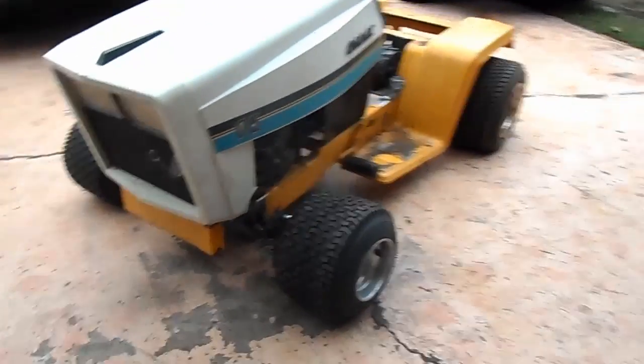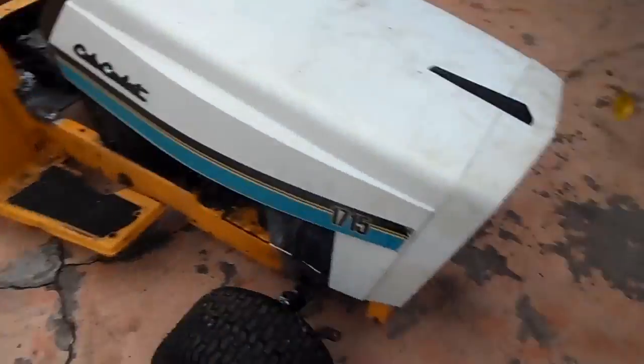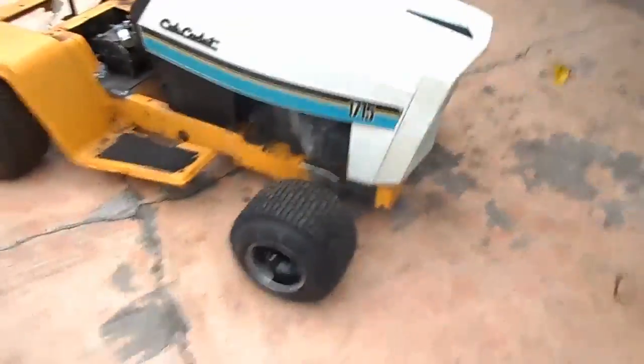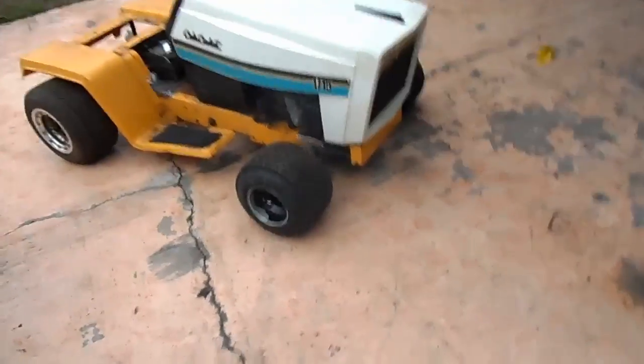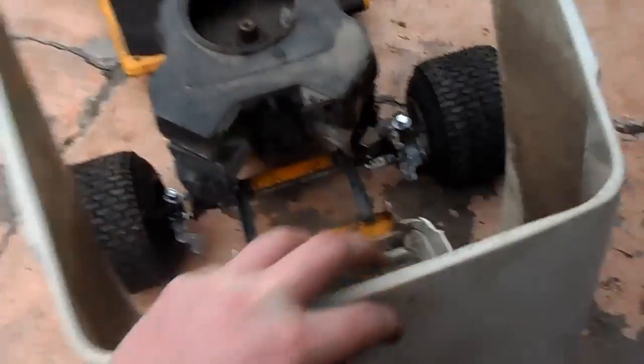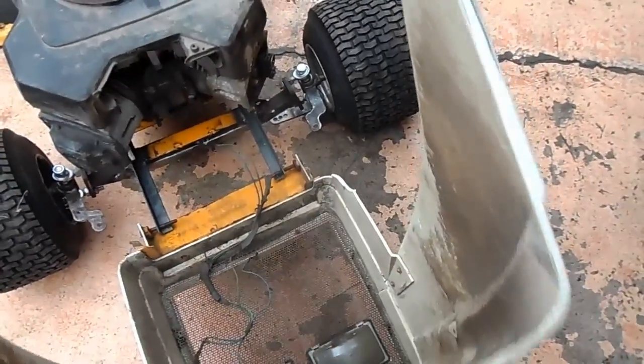Alright, last part for the day. I've got the hood mounted in there. Just a mock-up motor in there. So you see, I just clear the valve cover on it. As far as hood mounts, temporarily I just have it mocked up. I got to put a chain here so it stops here instead of hitting the top of the dash.